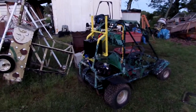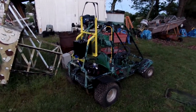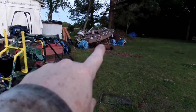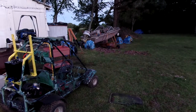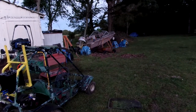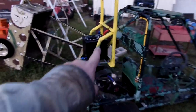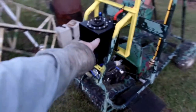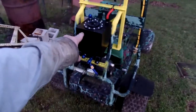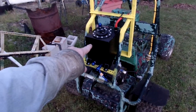That's where we're at on this one — I think that's a great idea for a fuel cell. Eventually I'd like to do it for that one over there too, and I want to put an electric start engine on it and maybe redo the rear axle system. My next fuel cell — I've got another one on the way — you can get these off eBay for 40 or 45 dollars, used for drag racing. My idea on that one is to put the fuel cell down low and use a pulse pump to feed the engine, so I don't have to build a big frame.